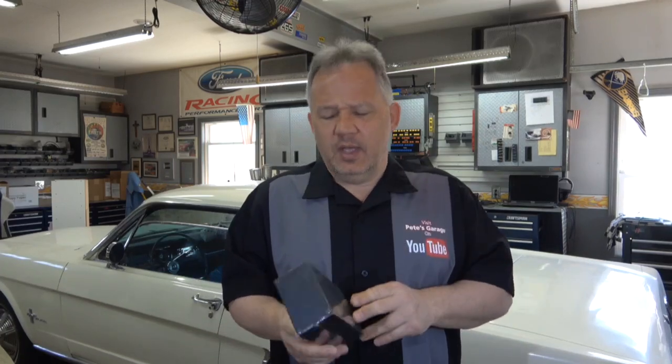Use quality products. I looked at many different ceramic coatings before getting a sample packet from Avalon King. Ceramic coatings range from about $50 to $120 depending on the package. There's a wide variety of types: some you spray on and wipe off, some cure with ultraviolet lights, and some — like this one — you wipe on and it has to cure for 48 hours before getting wet, with a full car wash safe after seven days. I'll put a link to Avalon King in the description.